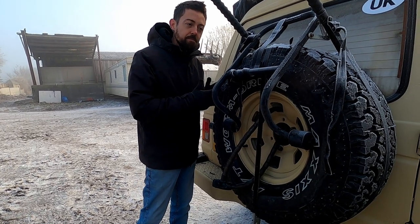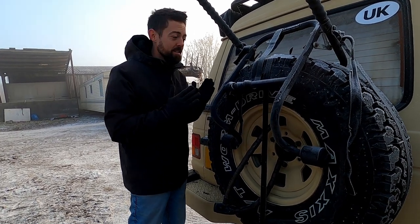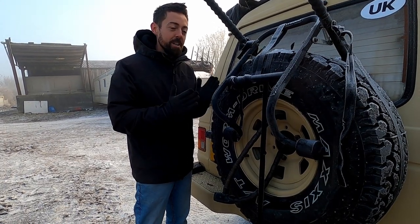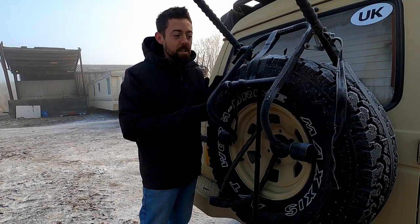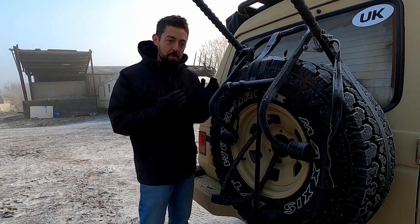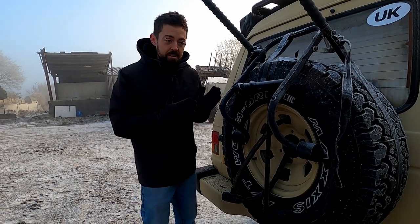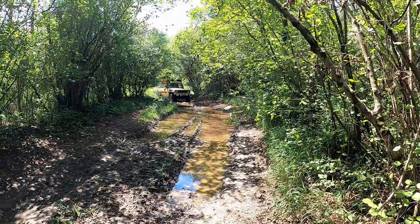We've switched to an all-terrain now, and I must say for these long-distance touring adventures it just makes sense. You get less road noise by far — although MOLLE is a noisy old truck anyway, so it doesn't matter too much — but you can definitely tell even on MOLLE, so on a quiet modern vehicle it's definitely going to be noticeable. Less drag, less wear. It's a different compound in the all-terrains; they tend to last quite a bit longer than muds because muds are a softer compound with more grip. Overall I've been super impressed with the performance off-road — done a lot of rock driving, some mud and slippery grass way up in the mountains across the Balkans.